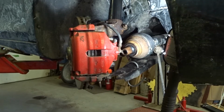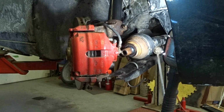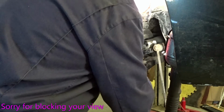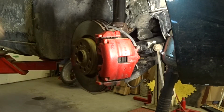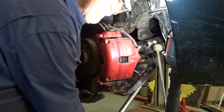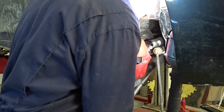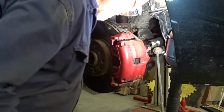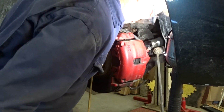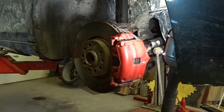So now I'm set up to get the ball joint bolts in, but we got to get this drive shaft in first. So orient it into the hole, and you may need to give this a little spin to get the splines to go in. Alright, so now get the bar, the hook, push down the control arm, and align the bolts, go into the lower control arm, and make sure the splines on the drive shaft are coming through.